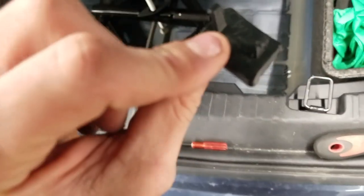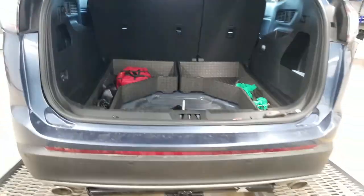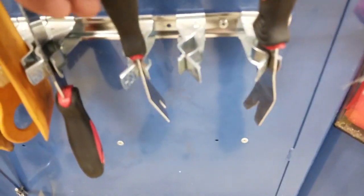It's just a little clip and it is very hard to get out without damaging the plastic. You can see that little mark right there — that's what happened when I tried using a screwdriver, and I found out that's not the best way to remove it. Get yourself a body trim tool; these bigger ones probably won't work, so you need a smaller trim tool for that.